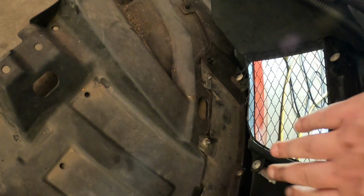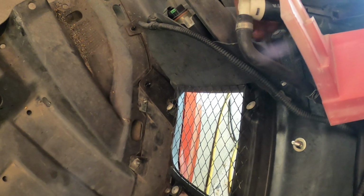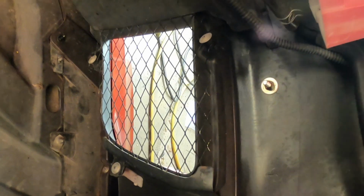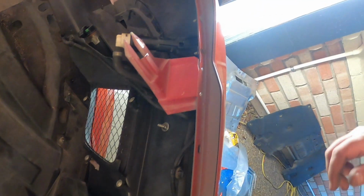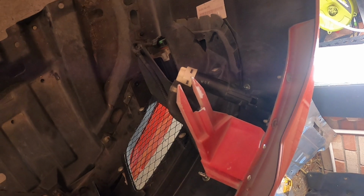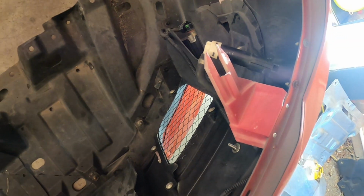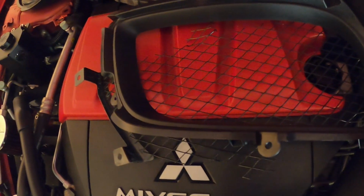So what we need to do is get out all of these screws, and take out this entire Foglight assembly area. So all of this will be replaced. So I've got a bunch of screws going around. Going to pull all this wiring off for the Foglights, as we won't be using that again. Might just leave it there in case we do put it back on to sell the car or something. But yeah, I'll disconnect everything, pull all this off, put a new one on, and I'll show you what that looks like. Alright guys, here is one side off, and here is what we're replacing it with.